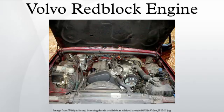Although a powerful engine for its time, the 16-valve engine can experience some problems that can be solved easily. One of the few problems is oil pump gear problems leading to broken timing belts. The oil pump gear itself can fail around the mounting flange, or more often, the weak 8.8 grade bolt holding the gear can break. It is strongly recommended to use a 10.9 grade bolt when replacing the oil pump gear.